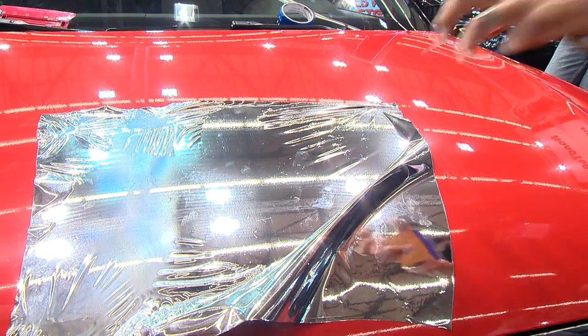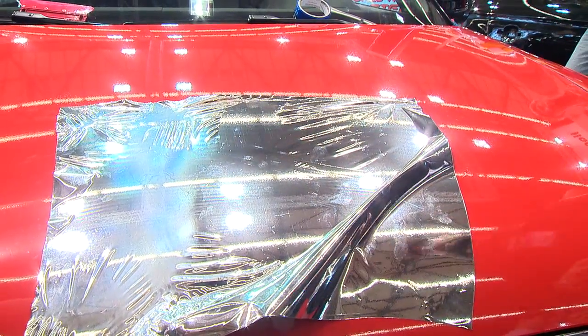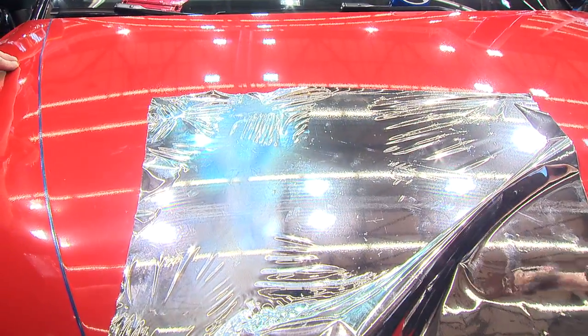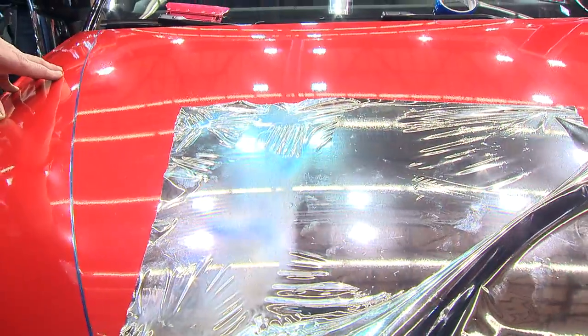And also, what happens is if you get those dull scratches from your squeegee, if I try to self-heal it, those scratches don't come out. Interesting, okay? So what does that mean as an installer? It means that I have to use a different buffer. This is a very popular buffer, the Monkey Strip. If I use this on chrome, it will scratch. So what I have to use is a wet app buffer and lots of soap and water, all right?